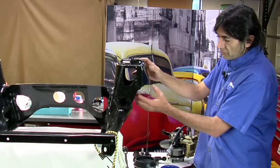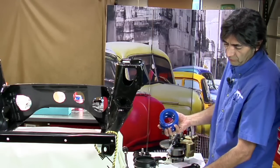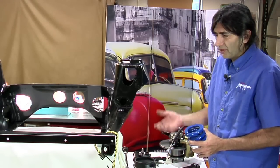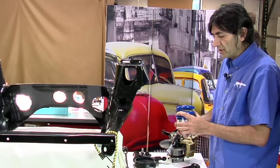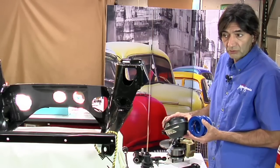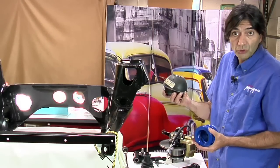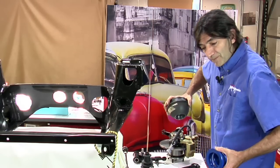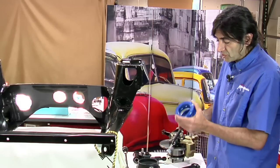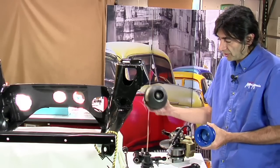This side has basically a bare subframe — we haven't installed anything because we want to show a couple of options. We have a set of coil springs which are quite popular because they're very easy to install. They're less expensive than the rubber springs and I think an improvement in ride. They're less progressive. These rubber cones tend to tighten up enormously as you approach a compacted state. In fact on the rear they don't even use a bump stop because these are only going to go so far. The Minis notoriously have that compression where it gets harder and harder until you hit almost a really hard stop. The springs tend to give a more consistent deflection without a lot of increasing progressive rate.